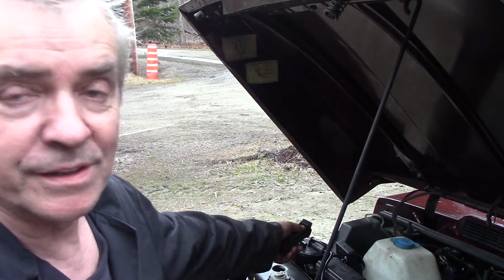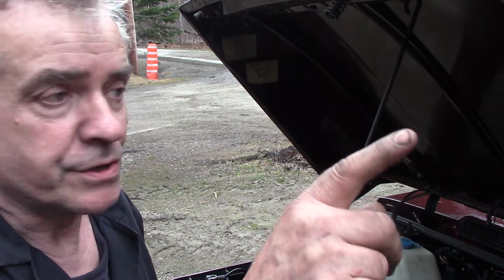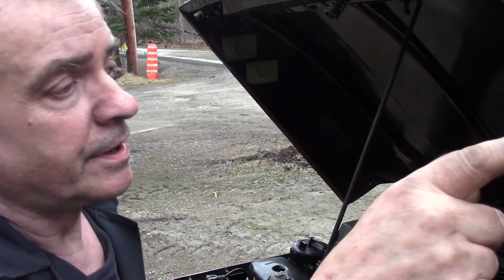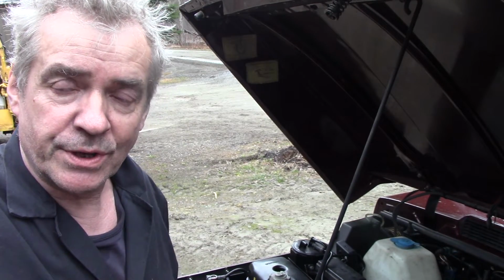But just to let you know, there were no wiring issues at all, not even with that box over there, the relay box, because this is working off the original wires. So I've jumped the wires from the right hand side to the left hand side. So I've got to put this on the lift to make a nice new connection going from one side to the other. But the connection seems to be alright, the relay seems to be alright, but it was just the pumps.